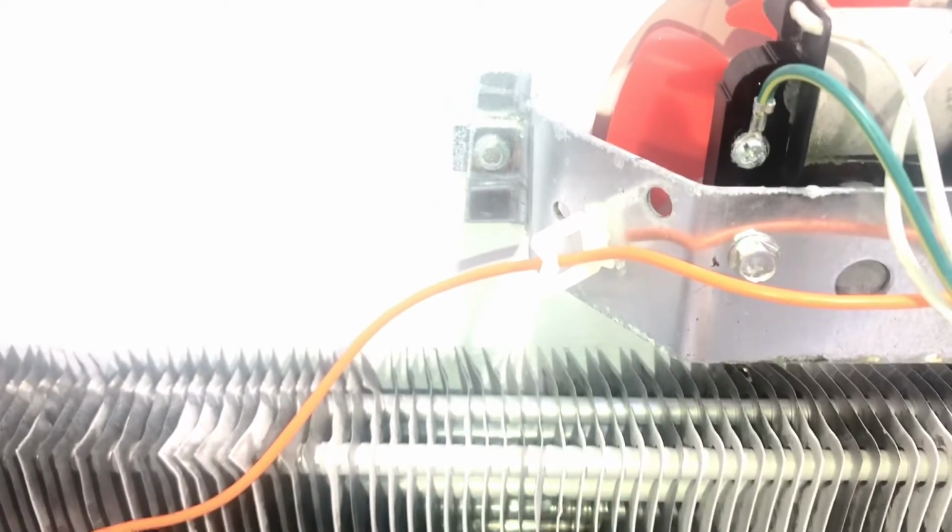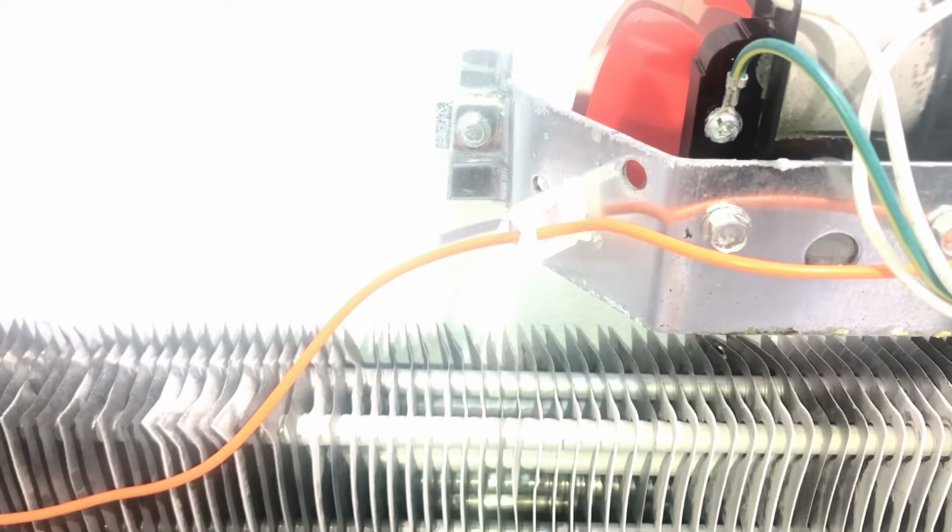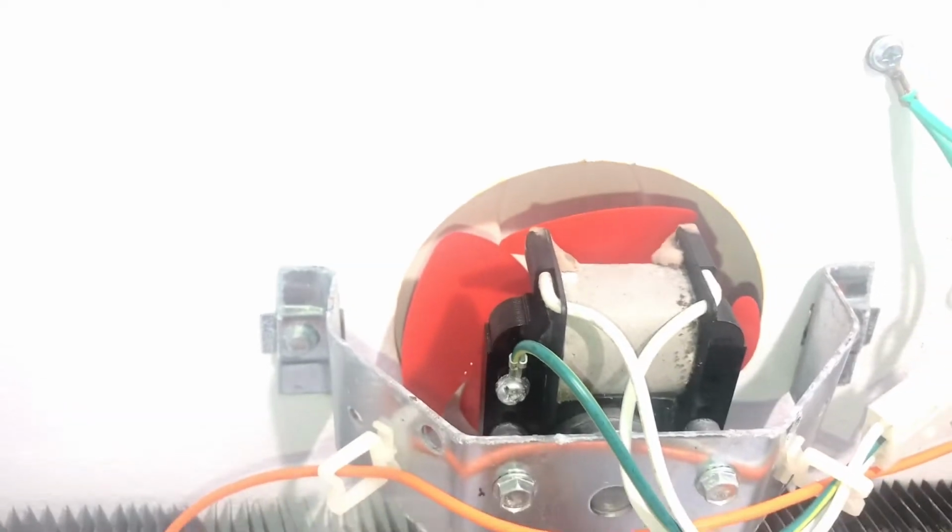So we're going to either change the fan, or we're going to pull the fan out and see if we can rotate it. Sometimes you can take it apart to save it. It's not always bad. Sometimes they get stuck because people, when they close their freezers, leave the doors closed, and what ends up happening, the fan literally gets a little bit of rust, and it doesn't take much for them to get stuck.